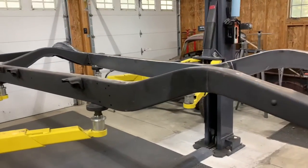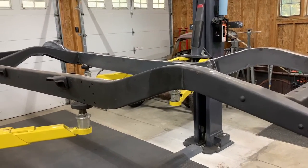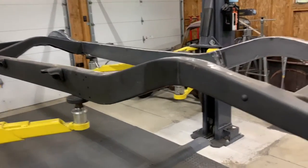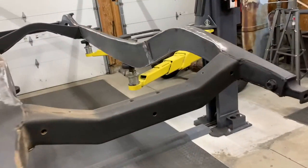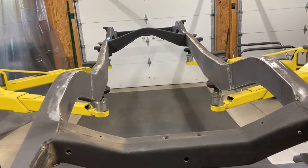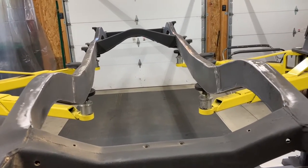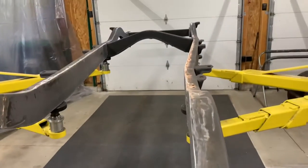When I get the suspension I can grind what I need off and then just spot prime from there. That's the idea, because I don't like keeping things in bare metal. I know some people like to build off of bare metal but I don't typically do that — it's too much of a risk for rust. So I'd just as soon get it into primer again as soon as I can.